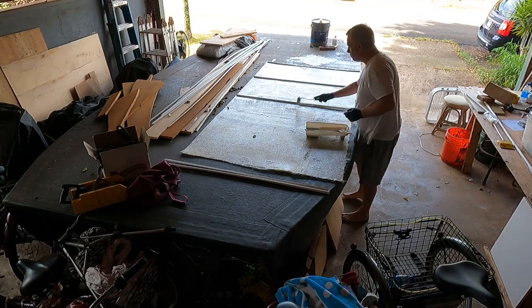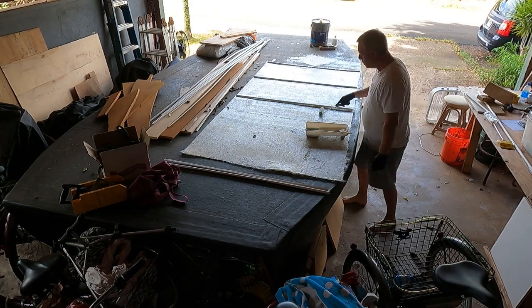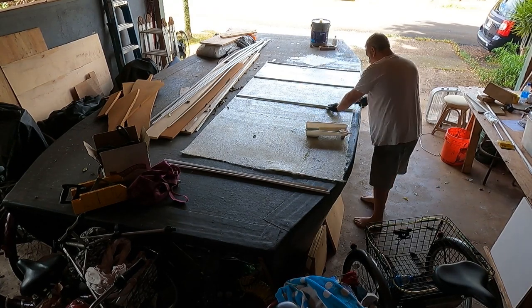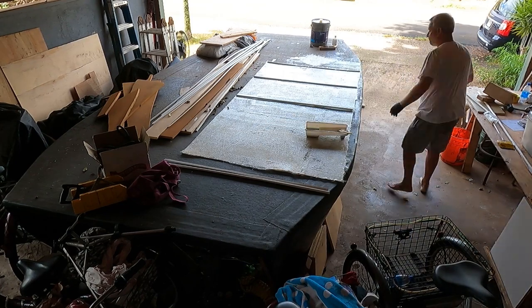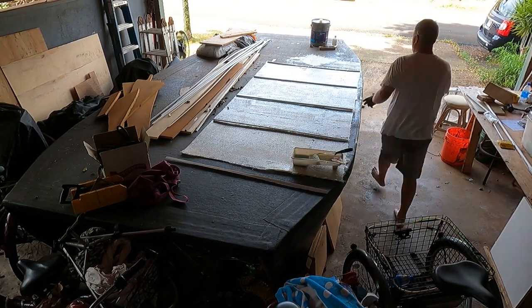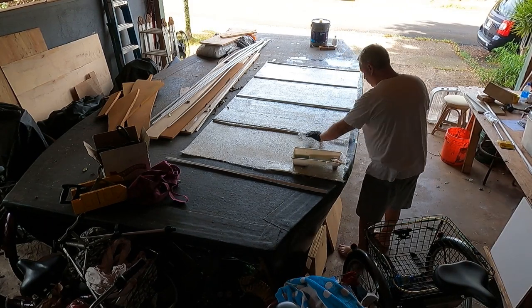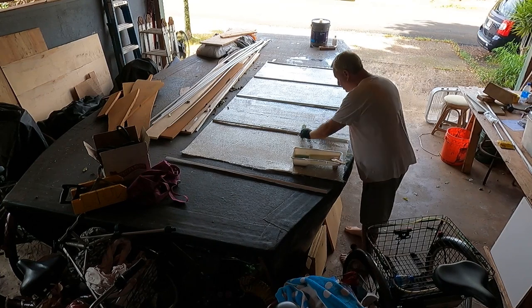One of the convenient things about using chopped strand material is that you can simply tear off strips. The rough edges will blend almost seamlessly into the existing fiberglass substrate that you're adhering it to. To make the material patch nicely, I make sure to tear off any of the factory edges, as those will be readily visible when you fiberglass them to the substrate.